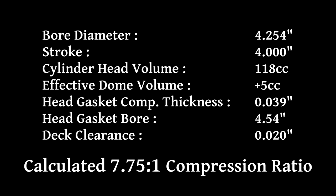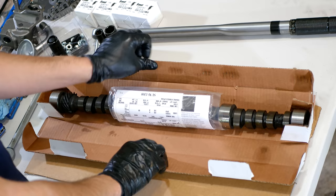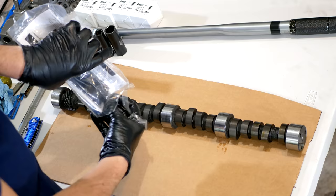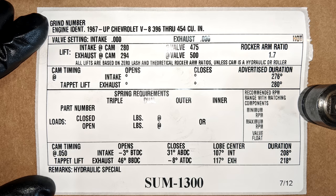I'm happy with that number and I think it'll work out nicely for our low-end supercharger setup. Now that we've sorted that out, we'll level the engine again and get ready to install the camshaft. This is the new one I ended up choosing for this engine — it's a Summit 1300, specifically a K1300, because it comes with a new set of flat tappet hydraulic lifters. It's a mild cam that should play nice with forced induction and keeps the overall valve lift under 500 thousandths, which is about the limit for the factory rocker and spring setup.